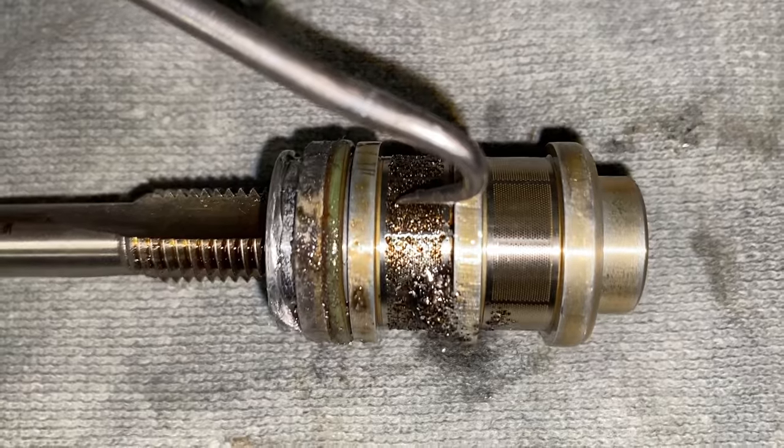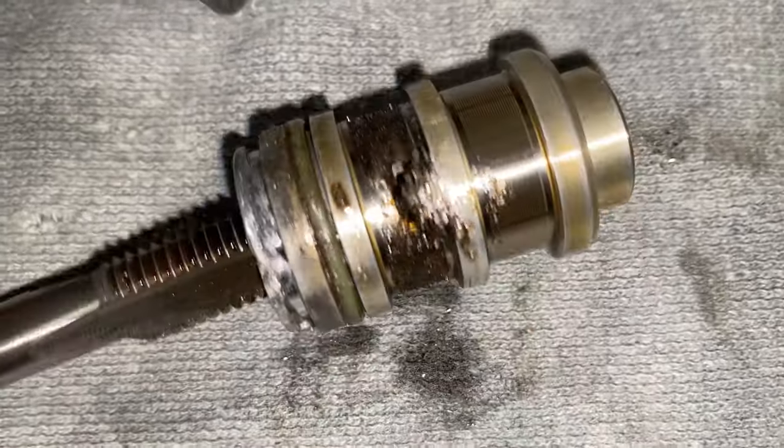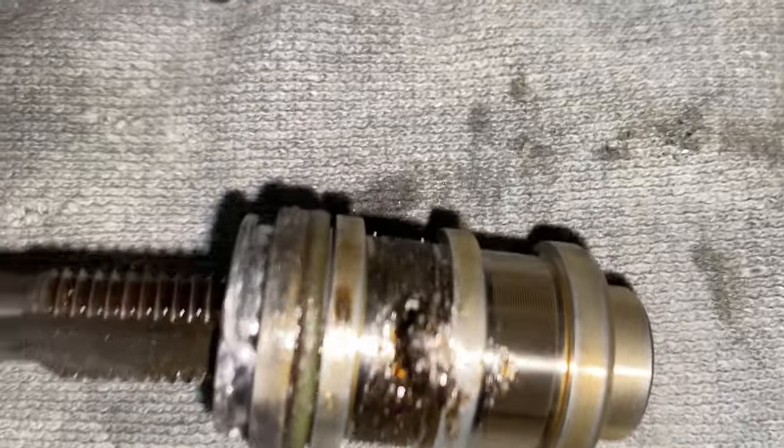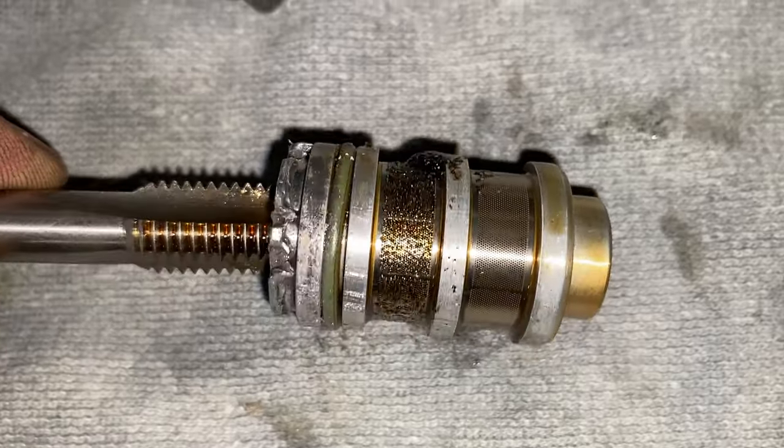You'd have to sleeve that. But that's absolutely, it's goosed, isn't it? I mean, if you're wondering why it's got an oil pressure problem. If you've got an N43 and you don't clean this valve out, you're daft, because that's the reason.